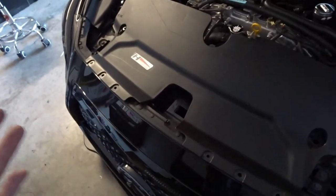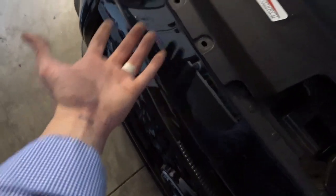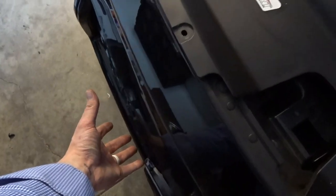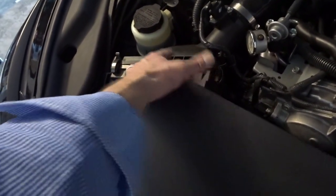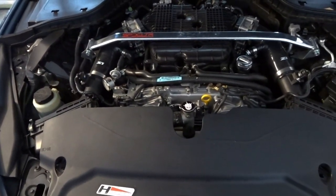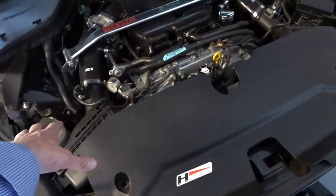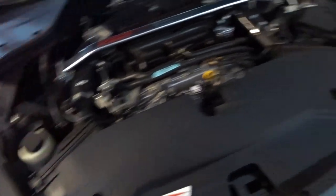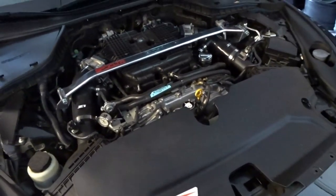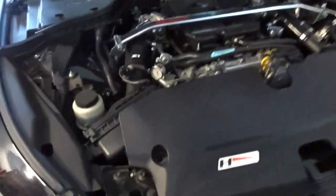When I say you don't necessarily need cold air intakes for this car, I'm not saying they don't perform — specifically the Takeda, which uses the factory air boxes and still gets cold air directly from the grille. The middle section was all wide open so air moves in and gets diverted into the filters on both sides. It's a really good setup. Long tube intakes that put filters way down in the lower grille aren't getting significantly cooler air. It's hard to say if you gain one or two horsepower. Do you want to spend five hundred dollars for that? Drop-in filters are the best bang for your buck. You can get Z1 intake tubes for around a hundred bucks.